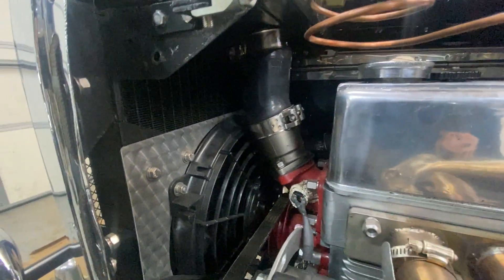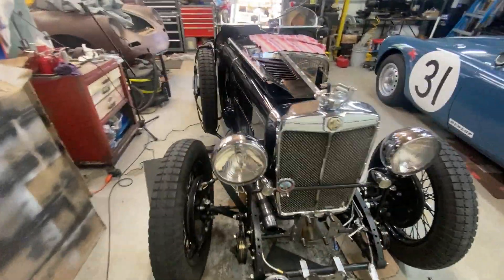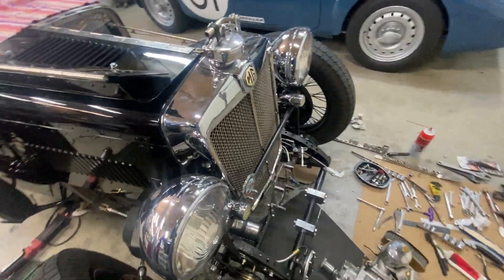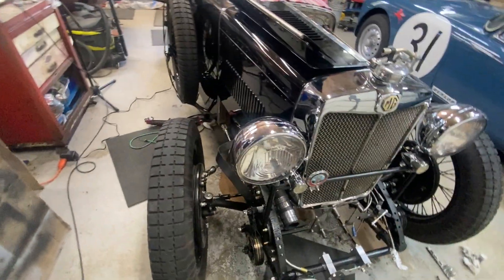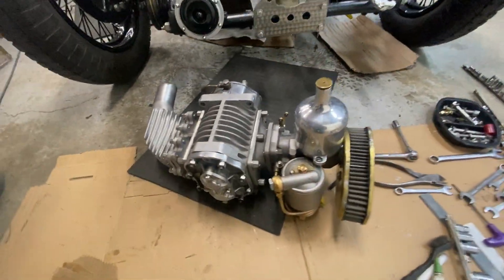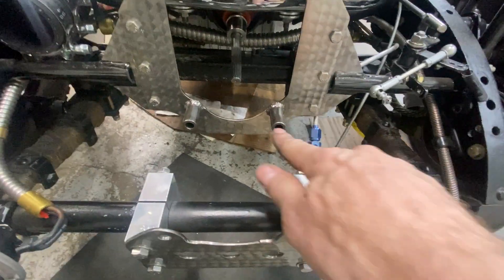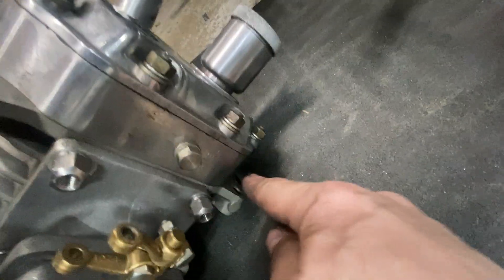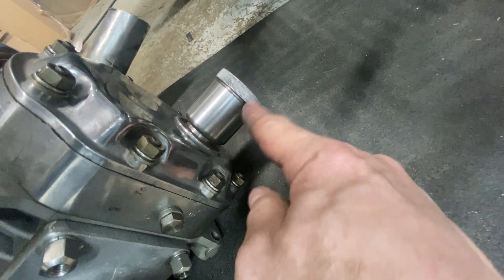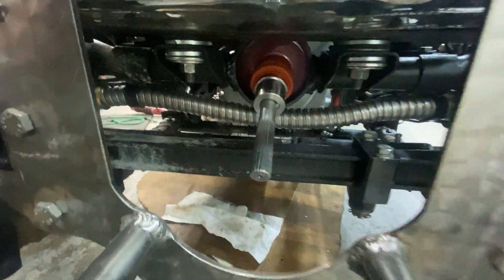I've hooked up the radiator hoses. There's a little trick where you smear a little bit of gasket sealer on those hoses and then tighten up the clamps — they don't have to be super tight because that gasket maker will make up for some of those little irregularities in the surfaces. The supercharger is just about ready to go back on its mounts. I measured the offsets from the supercharger mount here to the nose of the universal joint — basically the dimension from there to here.